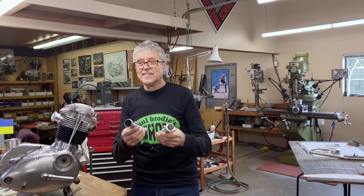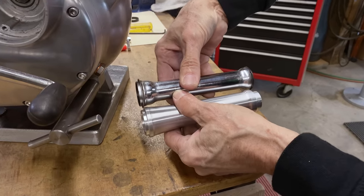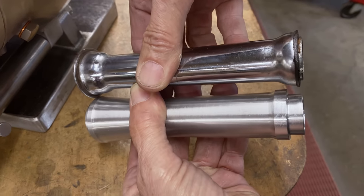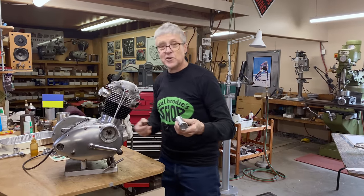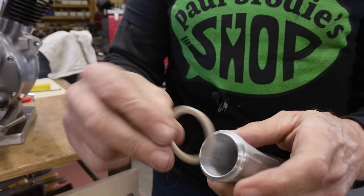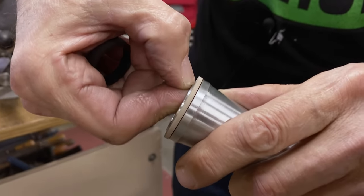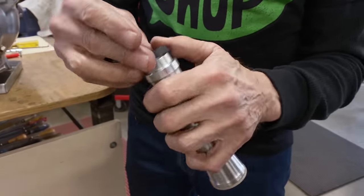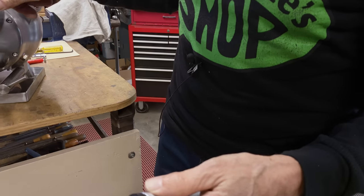Now I go from fabricator to assembler. Can you see how much longer this one is on top? It's close to a quarter inch longer. I hope I got this right. Here are the O-rings — the whitish, off-white one goes on top. You can see there's a little shoulder there, but I didn't make it too long because I have to look inside and see how the pushrods are mating up with the rockers. The bottom one has a slightly larger shoulder because it goes down inside the case.